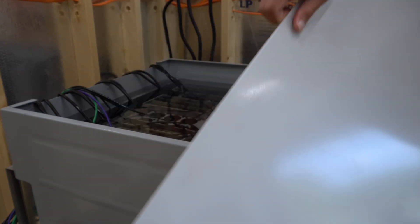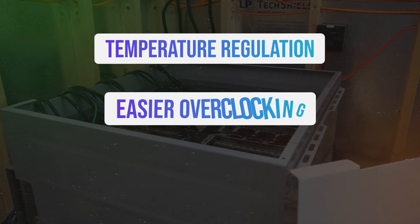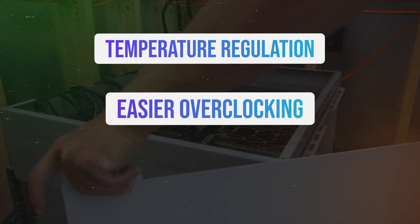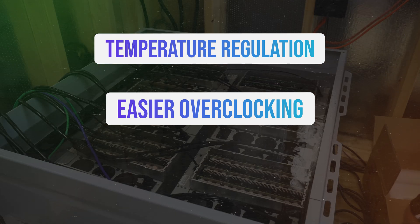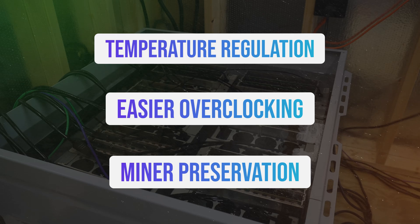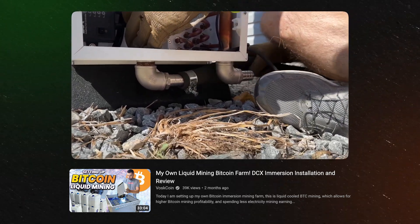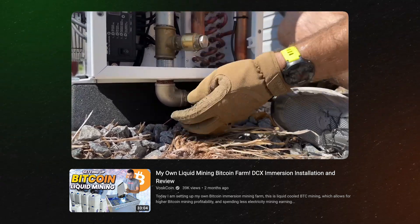If you're not familiar with immersion mining, it's very similar to air cooled mining except it's in liquid. A couple pros and cons about that: immersion mining makes it easier to regulate temperatures, and you can overclock miners a lot more. We will not be overclocking them just because of power capacity, but it is an option. Miners tend to last longer when they're immersed because they can run at lower temperatures. A couple of cons is that there is a little bit more prep and setup — you have your dry cooler, your tank, the hoses. There's also the dielectric fluid, which is cool to watch but a little bit messy.